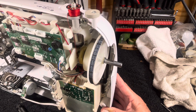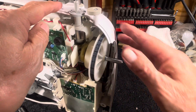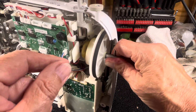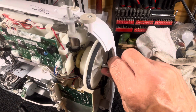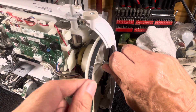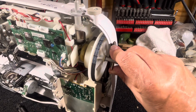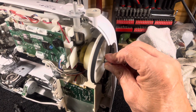To get that out, find the little end that's down there — just a tiny little end. You don't yank on it or pull real hard; you have to be patient. Pull it very gently with your pliers, needle nose pliers, or tweezers, and turn the hand wheel to unwind it. If it went on in one direction, quite often you can unwind it by going the other direction. If you pull it real hard, it'll slide down and pin itself — you won't be able to get it out. Hold it and unwrap it patiently.